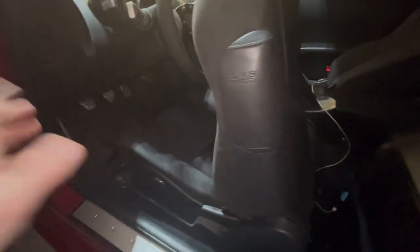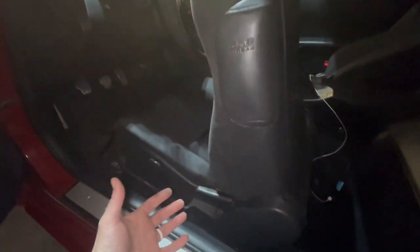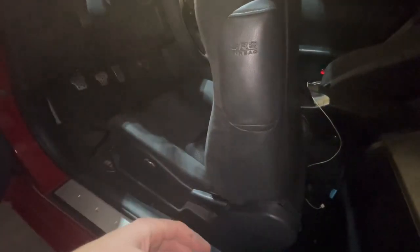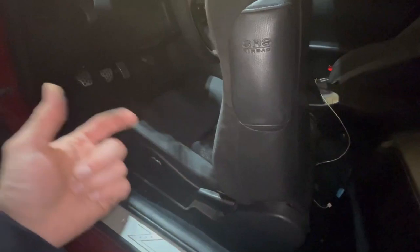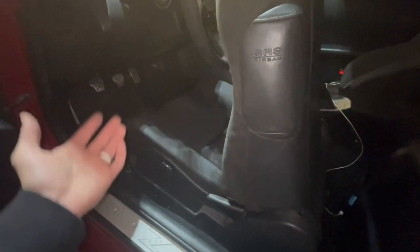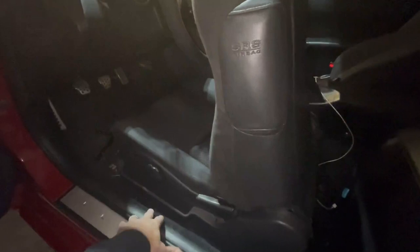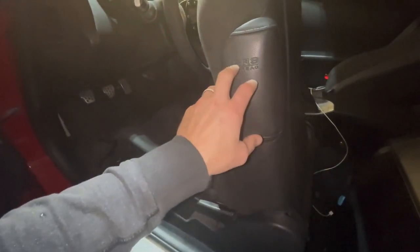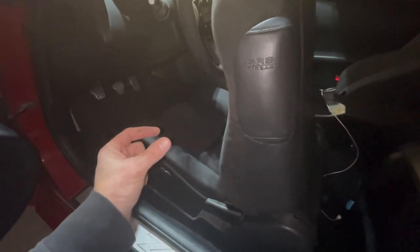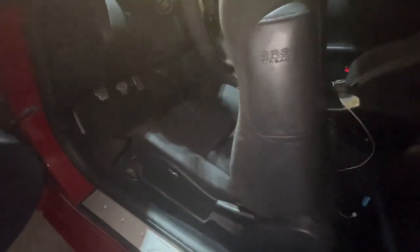Wait a while, press the brake a bunch of times to make sure all the juice is out of the system. Then you can get underneath the seat — you'll see the airbag connector. Disconnect it, put a resistor in there. You can check out my Q50 video where I did that too. Then plug your battery back in later and it should prevent the airbag light coming on. If the system detects the connection isn't made, the light comes on and the dealership has to clear it — it's a nightmare.